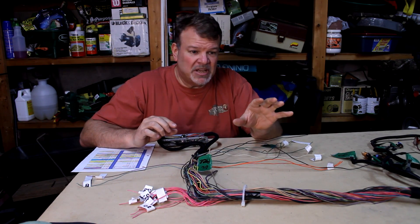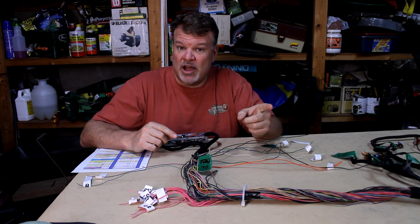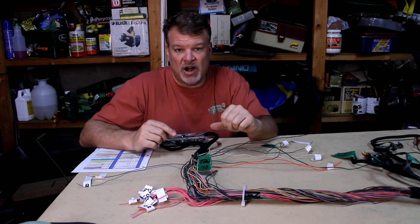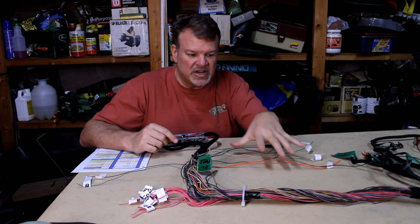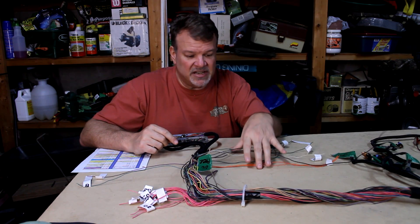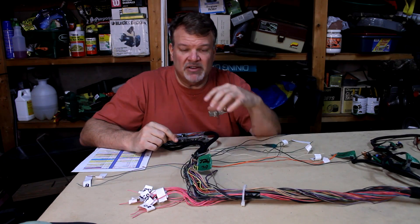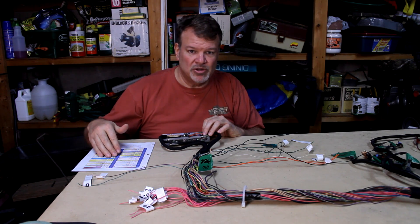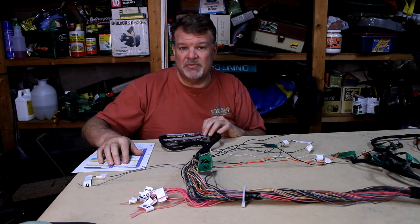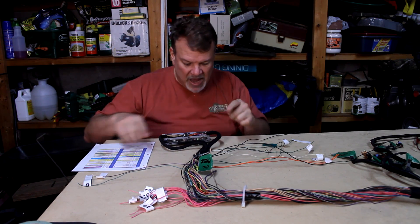So the usage for those three wires I just described is going to change — I wanted to leave that footage in because it was important to understand that when the process is over, you're going to have some wires left over, so figure out what they are and do something with them. The black ground wire is now tapped into the wiring harness ground, and I've extended two ground wires from it to this location. The gray wire is my coolant temperature sensor wire and it belongs in pin 41 of the blue connector. Brandon from lt1swap.com confirmed pin 41, even though my chart says it should be a black wire there.